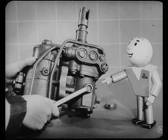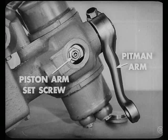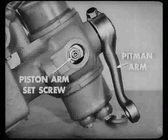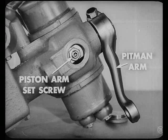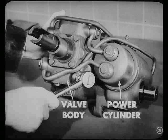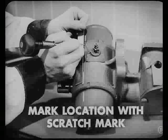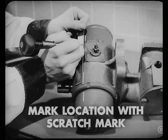If you find that worm gear compartment filled with fluid gear oil when you go to drain it, be sure and put non-fluid gear lubricant back in when you assemble the unit. Right here, after you've drained the oil, it's as good a time as any to remove the piston arm set screw and also the pitman arm. Then we'll disconnect the hydraulic tubes from the valve body and the power cylinders with a socket wrench, and then we can remove the valve body. Remember that the cylinders must be reassembled in their original positions so the hydraulic tubes will fit, so the first thing we'll do is mark their location with a scratch mark.